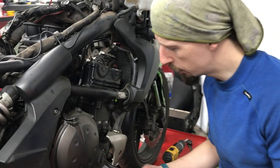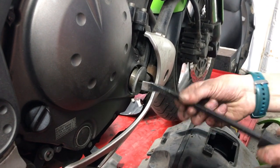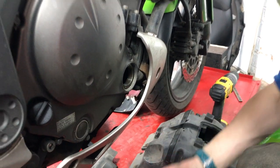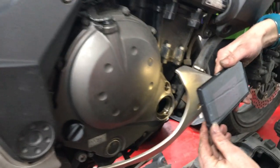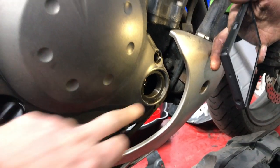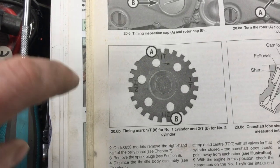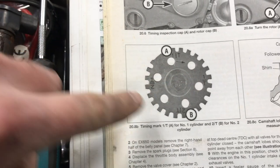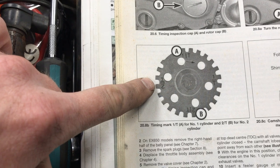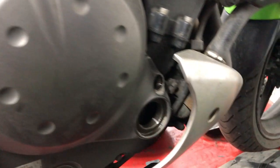What do we find inside? Gold doubloon! Kieran's just been rotating the engine around to top dead centre on cylinder one by putting a 17mm socket in there and looking through the viewing window until you can see the 1T mark. Now let's have a look at the manual. That's this mark here — there's another 1T there which is a different way around, and then 2T, and another 2T that's the wrong way around. But it is this one that we're looking for, through this little viewing port.